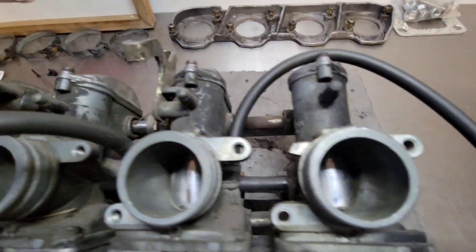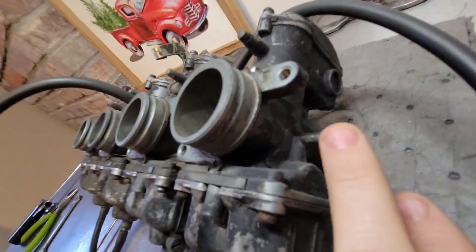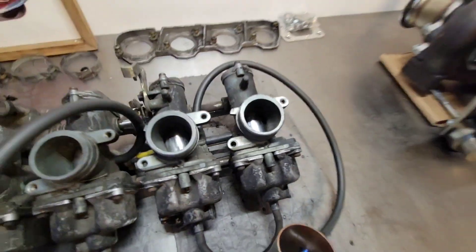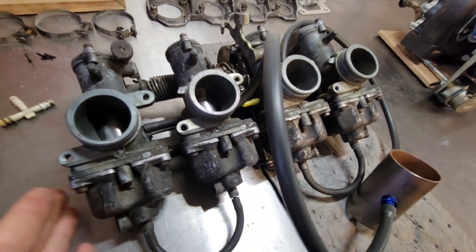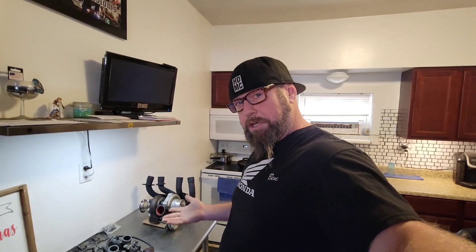That's how this is going to work — the bowls stay sealed down here, these tubes split off, that's sealed, there's a fitting down here on this end. From the factory this fitting is here but the air doesn't come out of it, so that one can stay just like it is. Pretty much all we need to do is get these bowls cleaned up, get some new goodies in there to seal all the fuel off, because the fuel and the boost must stay in the bowl. The seals have to be perfect on the bottom — if they're not perfect, fuel is going to leak out. Just get new gaskets and they'll be good to go. Then once we get some boost going through it and get them fine-tuned, that's really all there is to it.